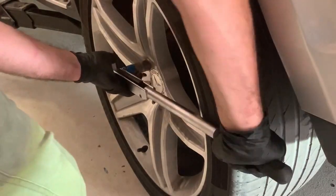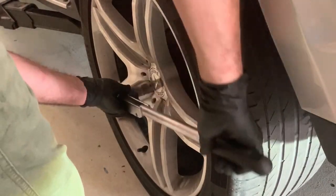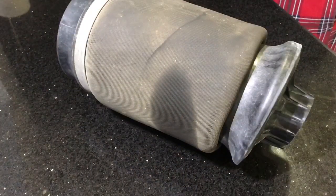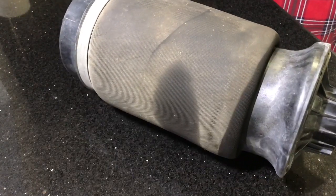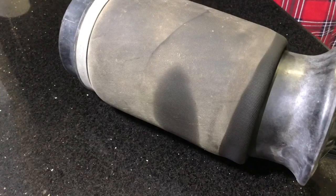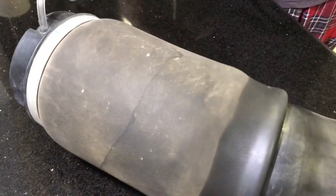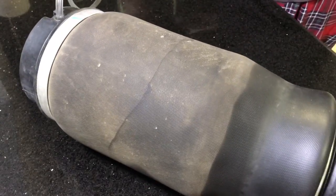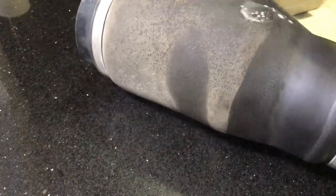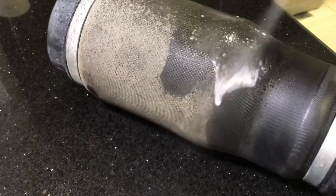Watch the video to the end if you want to know why I couldn't trace the leak with the spring installed in the car. At the bench, I used the hand pump to barely inflate the spring, which made it fully open and exposed the leak that couldn't be seen with the spring in the car. If you pause the video, you will be able to spot the location of the leak before you see the bubbles.